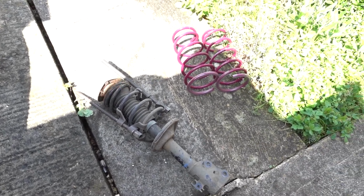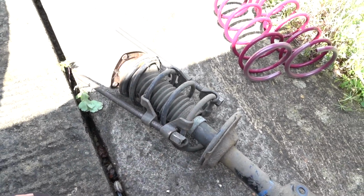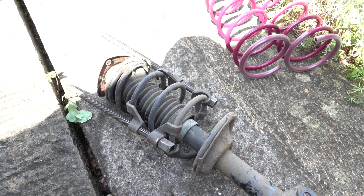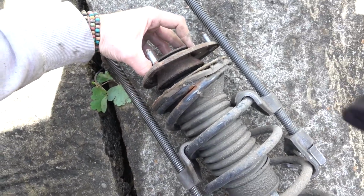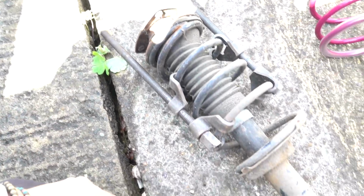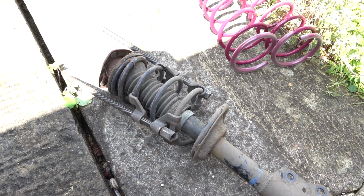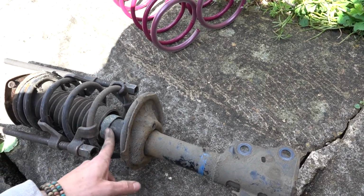Right, now what these are is absolutely terrifying. Like I said, I'm sure people know this. I think there's plenty of videos out there describing it all, but spring clamps on. I'm going to tighten them down, compress the spring, whip off the top cap. This is absolutely haggard, so that's on the shopping list to get some new strut tops for this. Probably new dampers, to be completely honest, looking at the general state of them.